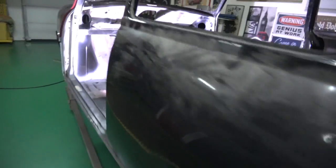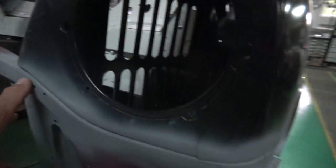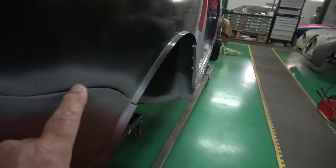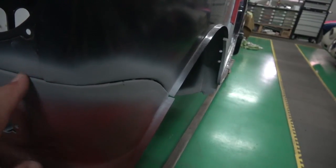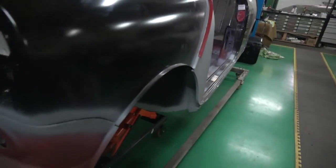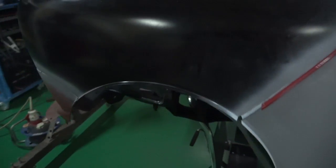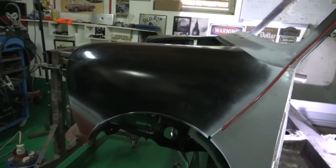Apart from that, you can see there's the little subframe in - very nice setup. You can see it's nice and lovely either side - so this is all in, this wing now. It's got a nice fit, you can see all the way down. I hate these panel gaps and what we do is we clean them down and then lead load across because they look horrible. Then obviously we'll cut the arch out and put the arch stiffener in it. That's really it for today.